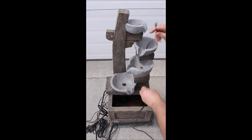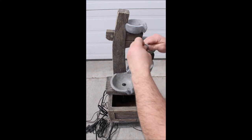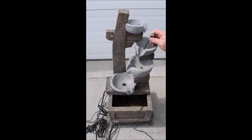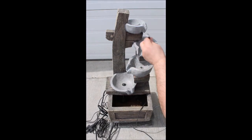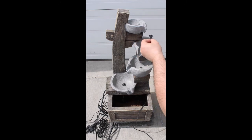Carefully add your grommet securely to the end of the light. Make sure that bulb is fully exposed over the grommet. Silicone is always your friend when attempting these repairs, as it'll secure that grommet in a little bit tighter into that top feature piece.